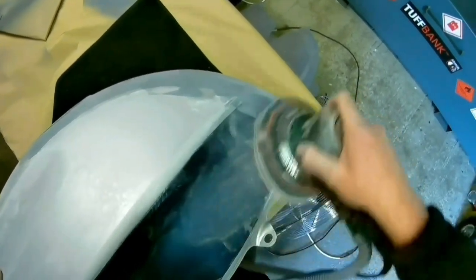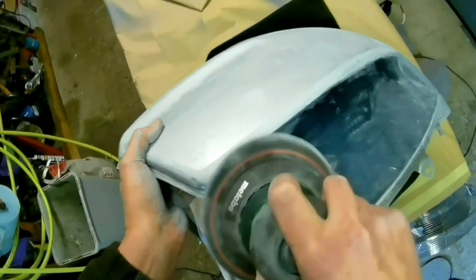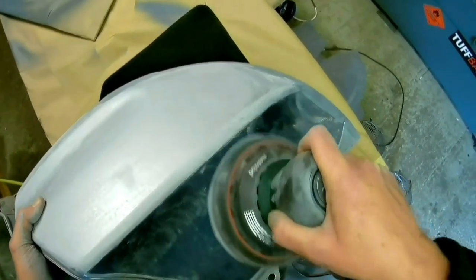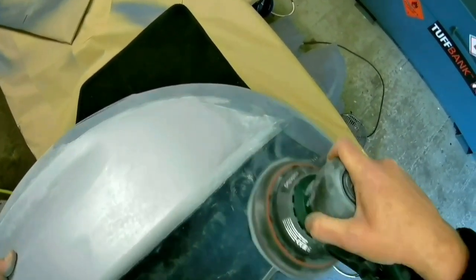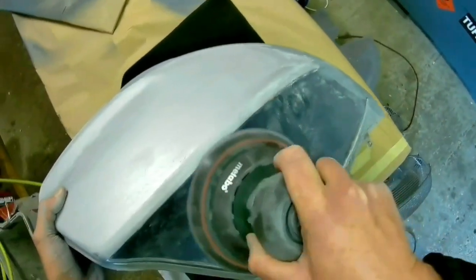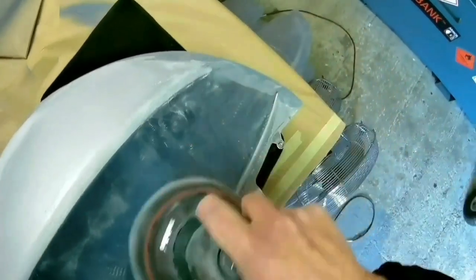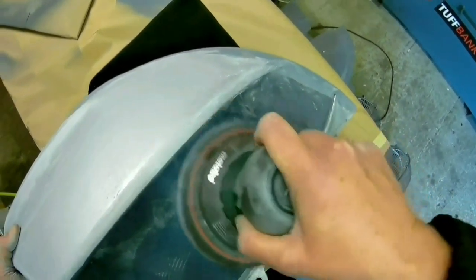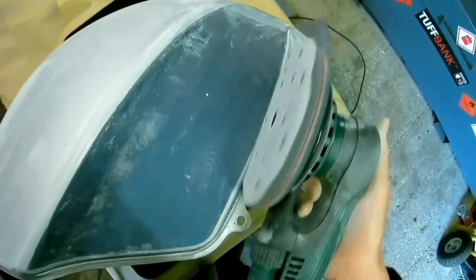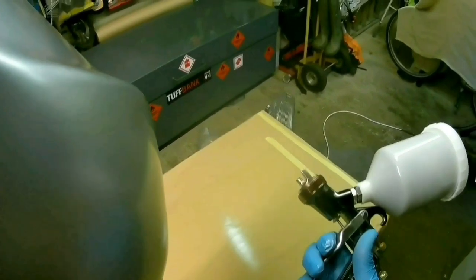We're getting a nice keen surface on the primed and lacquered tank so we can get a good top coat on there that will adhere properly and stay. It's questionable whether you actually save time doing it this way - you don't have to prime the whole tank all the time because the finish you'll get is just as good. In this case I didn't think it was worth it, and I thought it was worth showing people a different way. Primer for me is probably the worst part of spraying because it goes everywhere - horrible stuff.